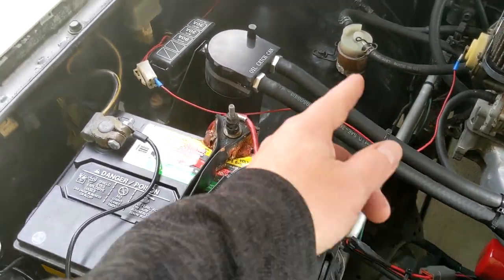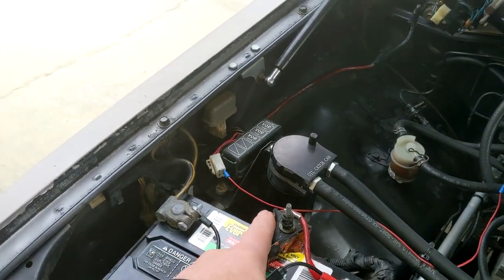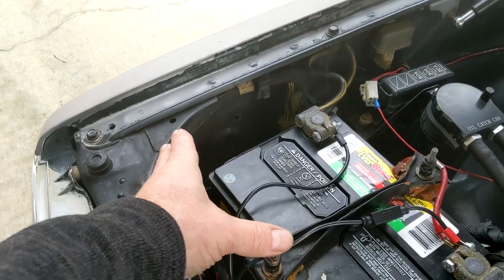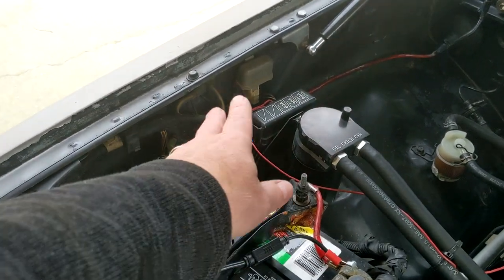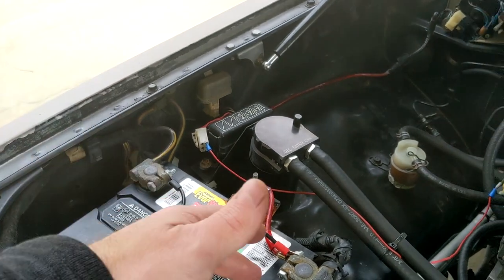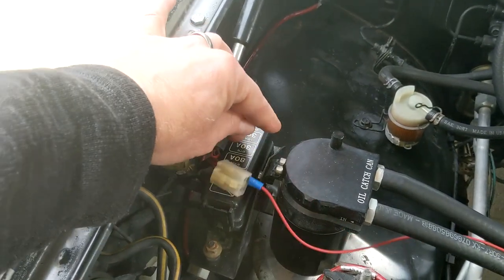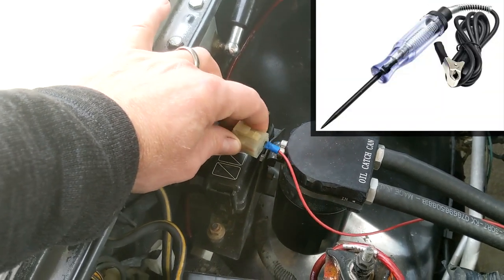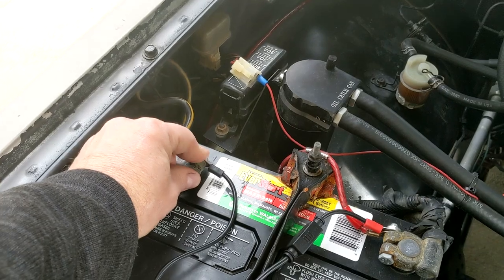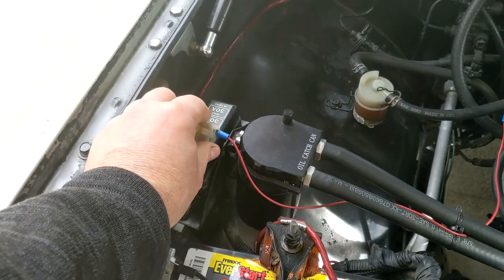What I like to do is find an alternative source. After cleaning up some of the wiring on this passenger side fender well, there are some leftover wires. I cut everything that went to the computer, but some of this wiring comes from the loom and went to several plugs I'm no longer using — things like high altitude compensators, vacuum modules, and so on. I took those out, but there are several plugs left. I used a test light — a circuit tester — that lights up when you find a power source. Ground it to your negative battery cable, turn your key to on, and start poking around looking for a power source.